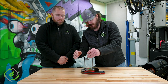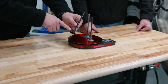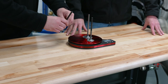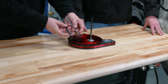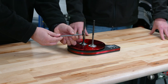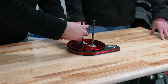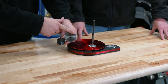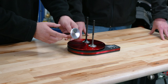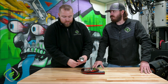There's also a back angle, which is the rest of this valve and how it faces off. After the back angle there is a radius right here, and even this radius will be different on any valve you have. You can notice the difference between the intake and exhaust valve having different radiuses. On the intake valve we have what's called an undercut — a neck down — which will be on mostly intake valves. You can also see a different dish between the two; some have a flat face, some have more dish, which is a good way to save some weight. And the last thing is the chamfer — the angle that splits the margin and the face — just to get rid of the sharp edge and give the valve a little bit more strength.